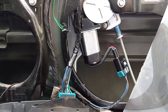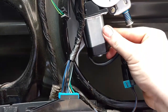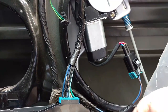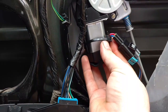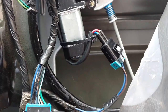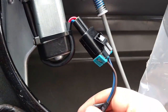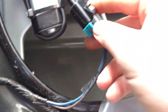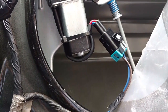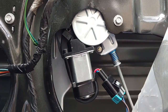A little tip before you slap it all back together: this motor came with free loose wires. The factory motor plug was actually fixed to the motor, so these wires can flop around. You want to secure that — I'm just going to wrap a zip tie around here and tighten that up. I secured it to the motor itself so it's not flopping around. This isn't going to get too much movement, but it's enough to hold until this regulator fails — which is probably in a couple of years, so don't worry about it being perfect.